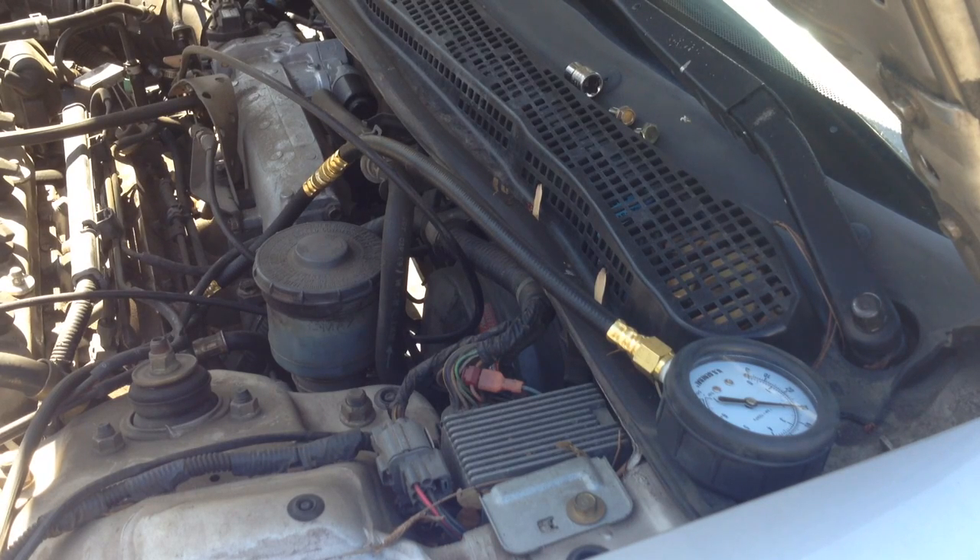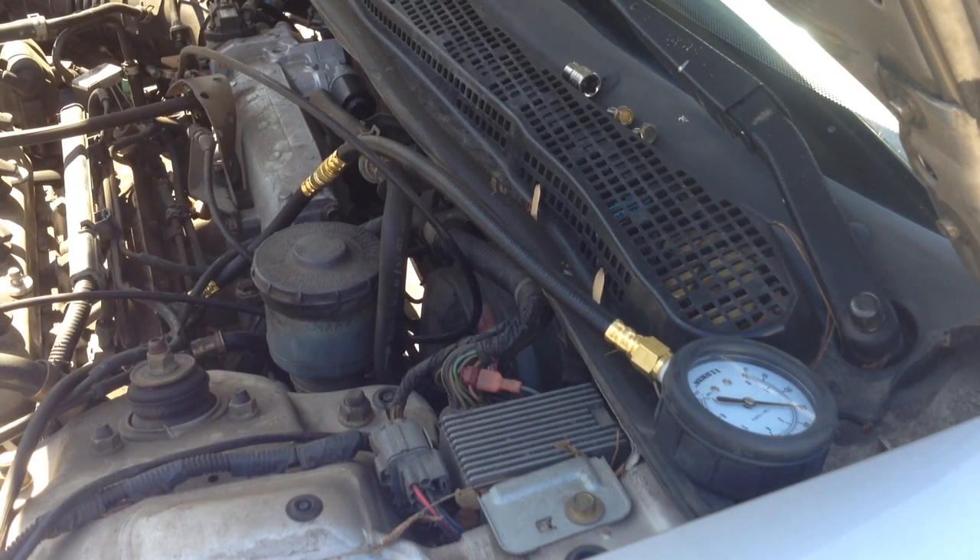If the pressure rose but the readings were higher than the specifications, you need to check for a pinched or clogged fuel return hose or line. Another test is for a bad fuel pump: if you crank the car and get no fuel pressure at all, the suspect is the fuel pump or the pump system — such as the main relay, a fuse, or a power issue. Once you have all this information, you can make a diagnosis. Go ahead and carefully remove your fuel tester line, replace the washer on your test port, and put that bolt back on snug but don't over-torque it. Thanks for watching, guys.